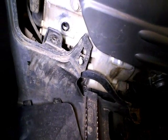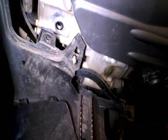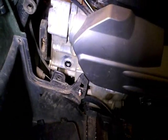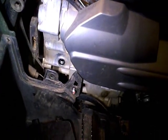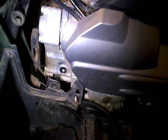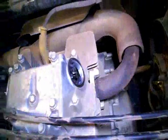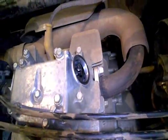And I've pulled it around until I got my little T on the flywheel. With the spark plug in, you'll find you need to pull it quite slowly. Otherwise, compression will build up as the piston goes up and push you past where you want to be. And I have to manipulate a light on this camera at the same time.